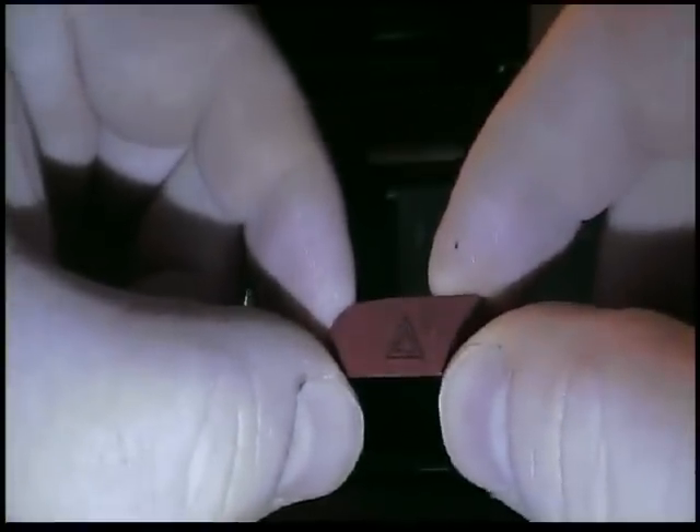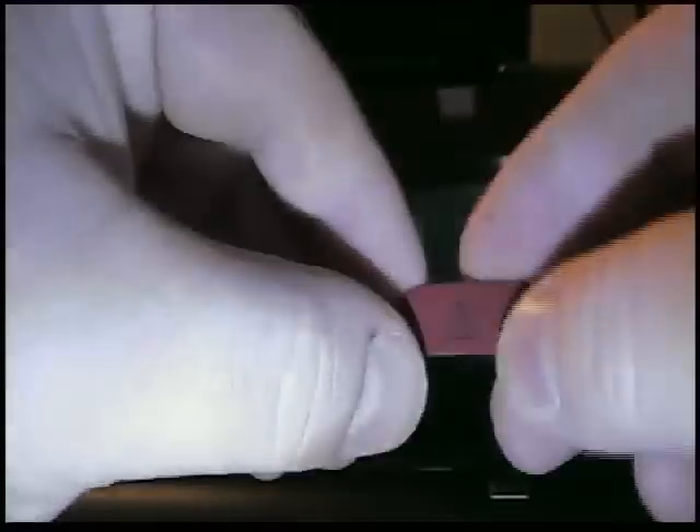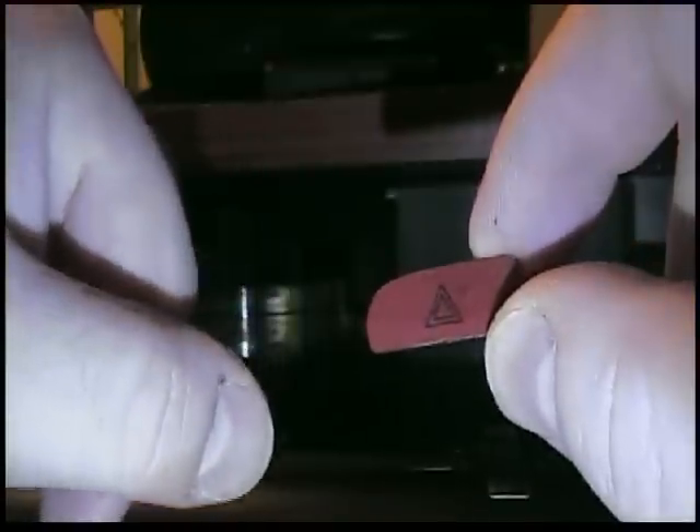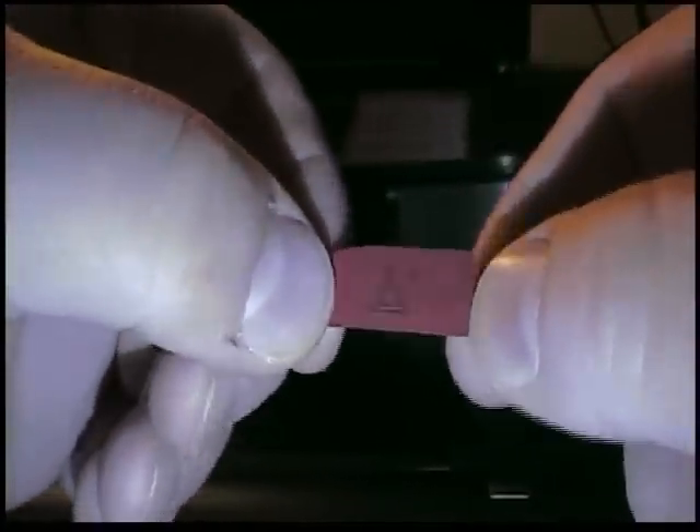This card is glued in on either side — it's not a really tight seal, obviously we're able to get it out. What I use is the cheapest toothpaste I can find — I got Pepsodent at the dollar tree. I used a paper towel and the Pepsodent on the top of this and rubbed it until I started getting color on the paper towel. It's a polishing agent and it will buff the surface out a little bit and take care of the flecking that happens on here. I would then clear this one with automotive clear paint or you can get spray can Krylon clear.